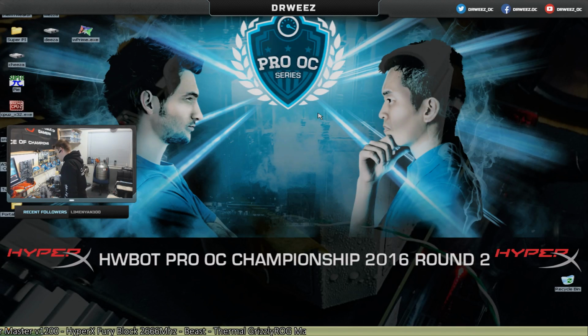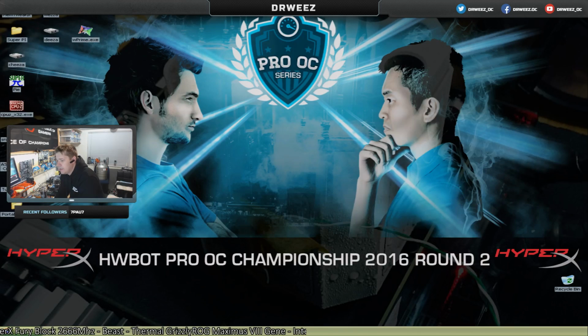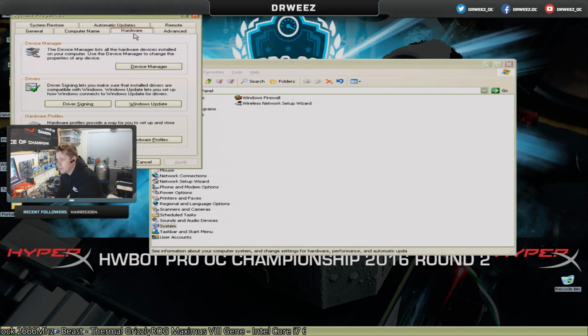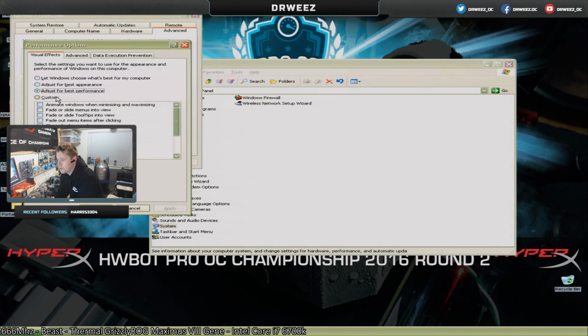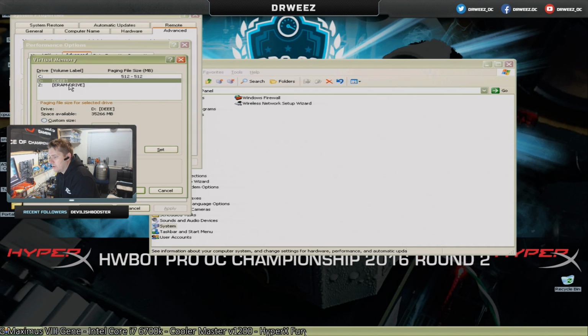Right, so I'm currently at minus 45 degrees. I'm just really cooling down a little slowly, and we might get back into the BIOS and start setting some clocks. So we are running wPrime, and for that we can change a few settings here in performance, and we can just go for adjust for best performance. Okay, system cache. Okay, no paging, file system managed, and we're going to custom.